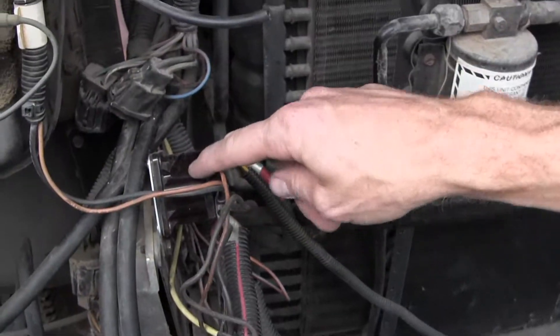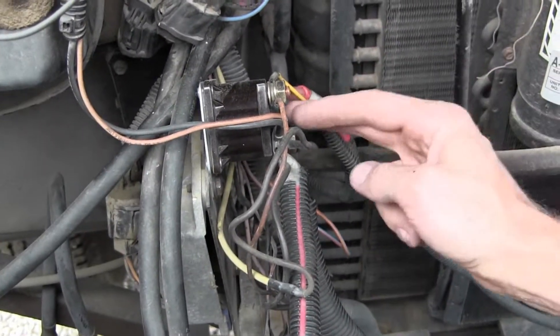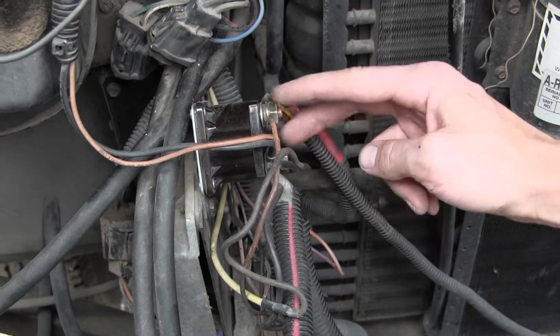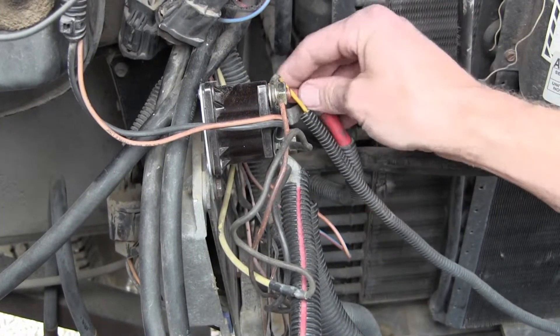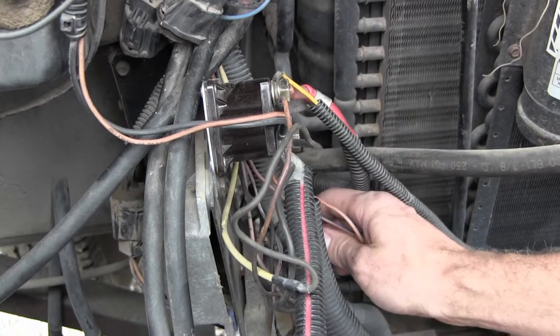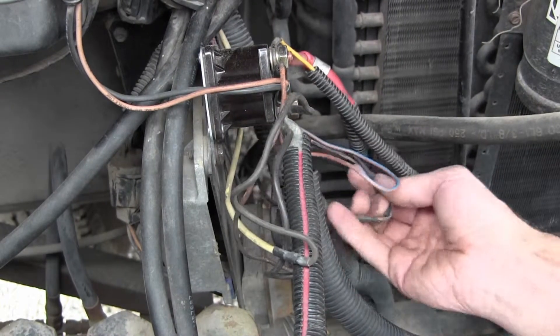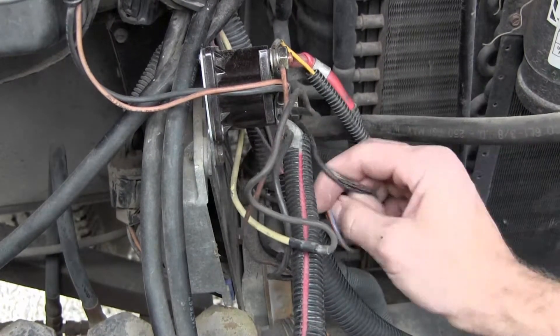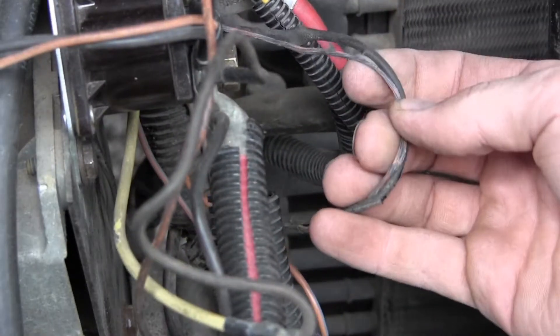So yesterday, this is the solenoid that starts it. Battery comes up — this is the auxiliary start battery — and it goes into this. As soon as you turn the key, it's supposed to jump these pins, which then sends the power down to the starter, which is this wire. I don't know what was shorting, but something was shorting. As I was testing things out, Tamsin was inside turning the key. And this wire — it started smoking, and the sheath just peeled right off.